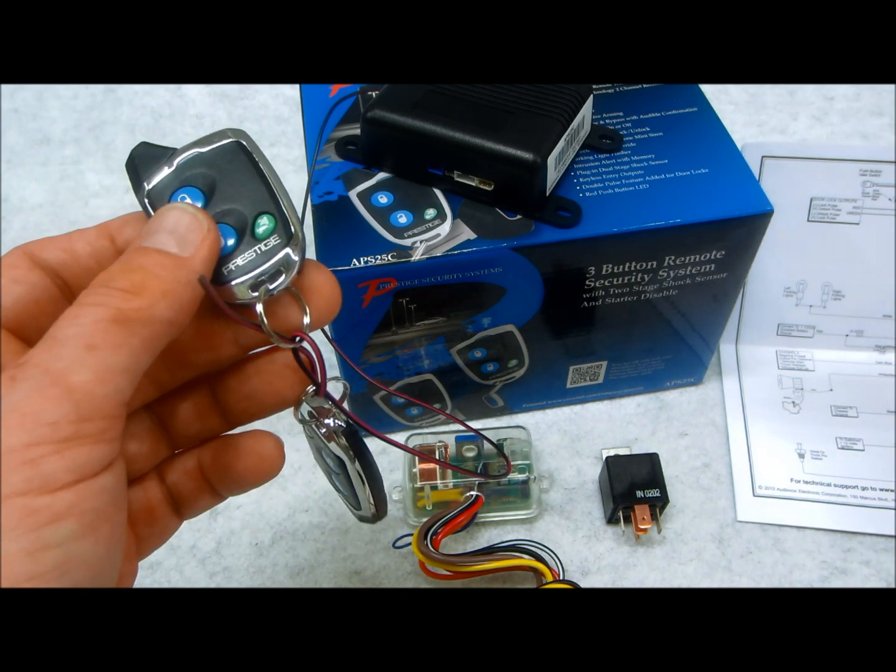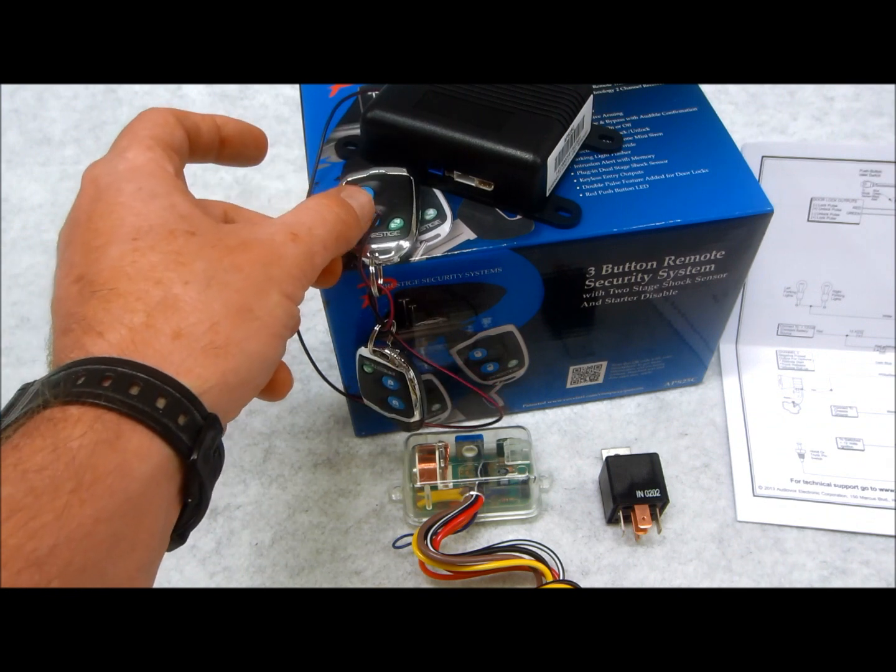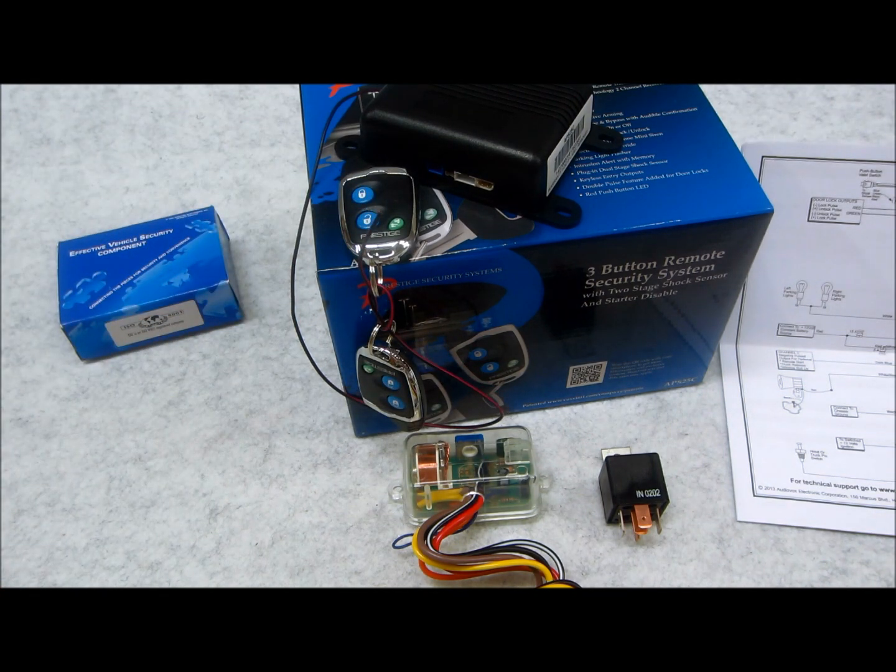For this viewer, he just wants a 12-volt system to transmit a signal and hold that signal. He didn't mention it specifically, but my presumption is he's running a diesel motor, because diesel motors often need a prolonged warm-up time — anywhere from 15 to 60, sometimes up to 90 seconds, or if you've got an old one, up to almost two minutes.